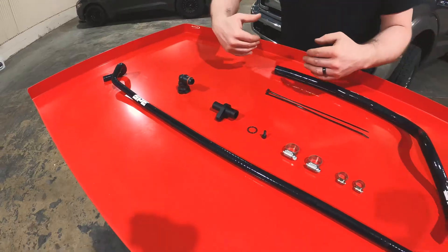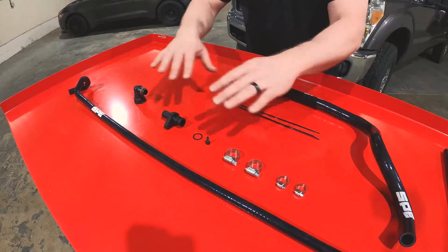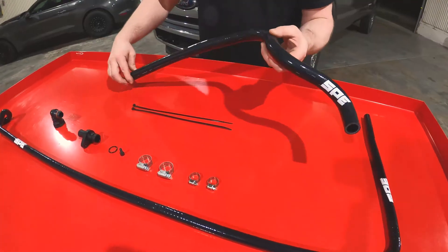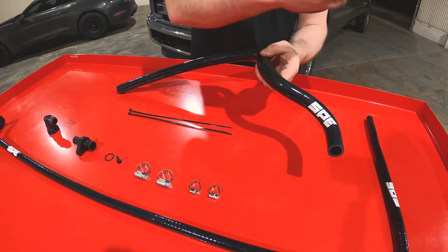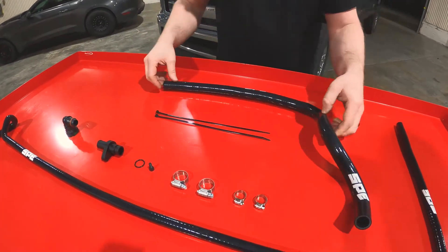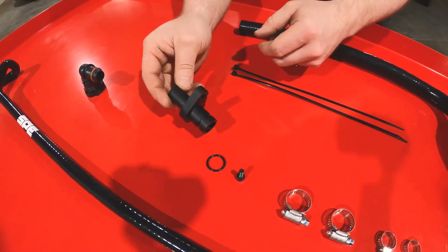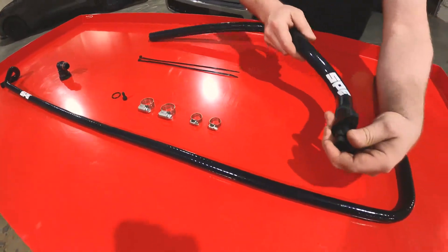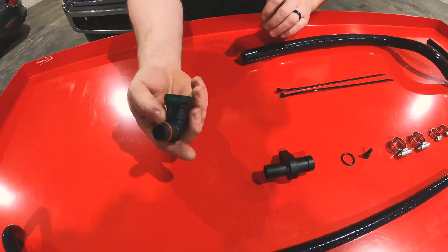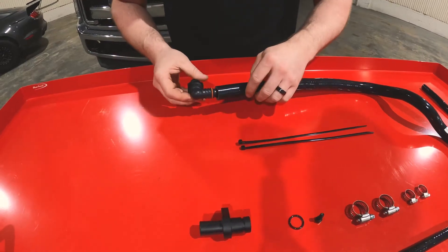It runs back to where the coolers are, and the heater inlet tube also tees into it. This cleans all that up, going right from the rad to the degas bottle. This hose goes from the heater inlet fitting and tube down to the heater core at the cab. All your clamps are included. This is the heater inlet adapter — it's a billet adapter fitting with an o-ring, and you get a quick connect fitting to go onto the heater core. It's a double o-ring internal fitting, actually a little better than the factory style.